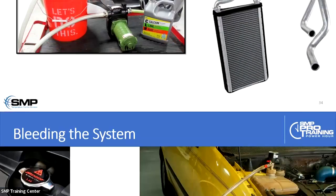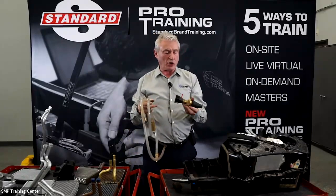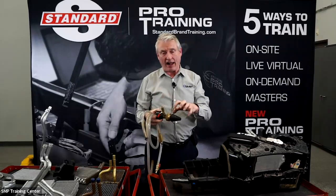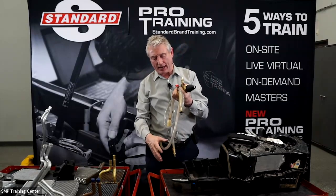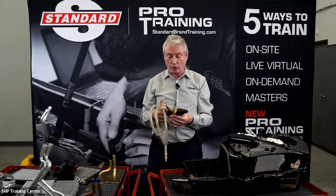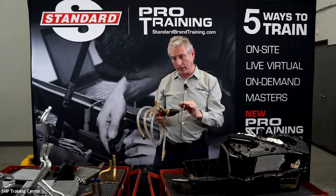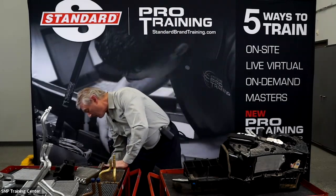To wrap up: don't forget we'll need to flush, bleed, and refill the system when we're done. I find the most effective tool for doing that is the airlift tool — this pulls a vacuum on the system initially, then we open the valve to draw the coolant in. This way we avoid the issue of an air bubble in the top of the heater core, which is often the highest point in the cooling system. An air bubble there can cause trouble getting heat back in the vehicle — the engine keeps cool, but there's no heat from the heater core. The airlift tool is the perfect tool for that.